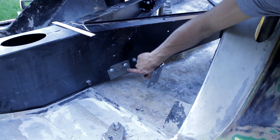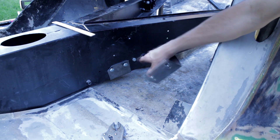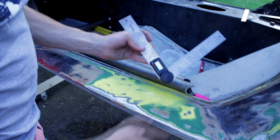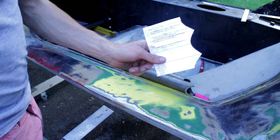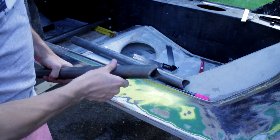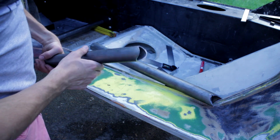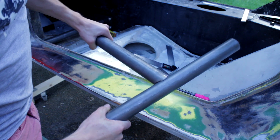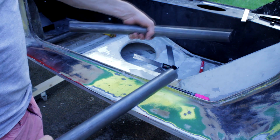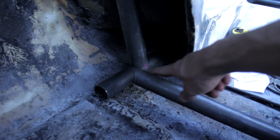This is the mounting plate for the rear outriggers — you can see it's bent 90 degrees, with a section of the plate going underneath to meet the same surface area as the front ones and be FIA spec. I've started using the templates for everything, using my digital protractor to determine the angle, then going online to print a template. This one has been cut out roughly with straight cuts to get close, then finished with the flap wheel — and it fits perfectly, at an angle of 82 degrees. Now we'll fit this to the chassis and connect the sill bar with the mounting plate.